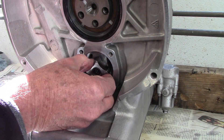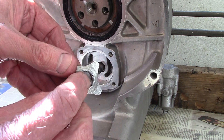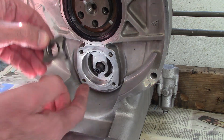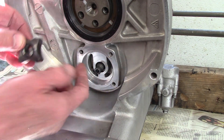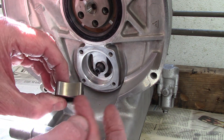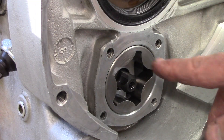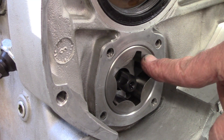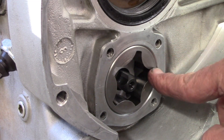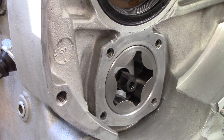The inner rotor pulls right off the cam on this model bike. If you look inside, you'll see there are flats machined on the hole of the inner rotor that match up with flats on the camshaft. The distance here is the thickness, so I'll take a measurement of that. There's another measurement I need to make: the end play between the rotor and the body of the engine block. The face of the rotors recess just a little bit in relation to the face of the block — that's called end play.